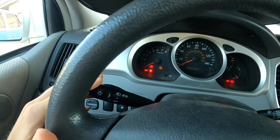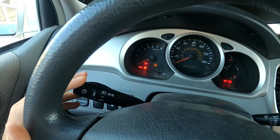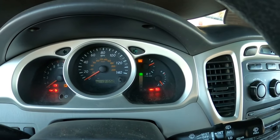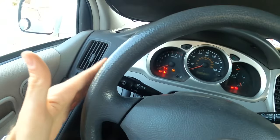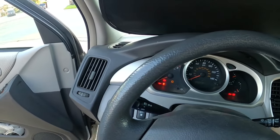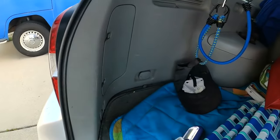In my case, it's actually a turn signal issue. You're going to notice you have a turn signal issue because the relay is going to blink really fast. You can hear it — now look at this side, it's much slower. So we know it's either the front or the back, and I've already diagnosed it to be the back. We're going to be working on the driver side.